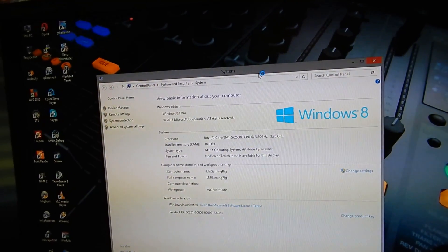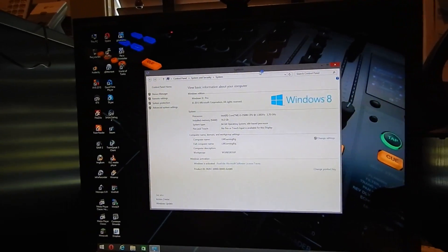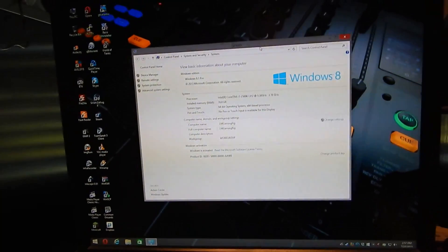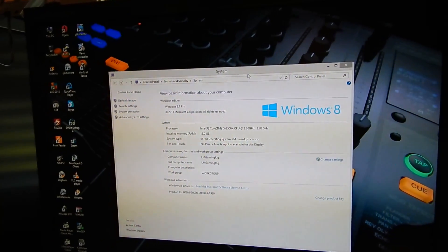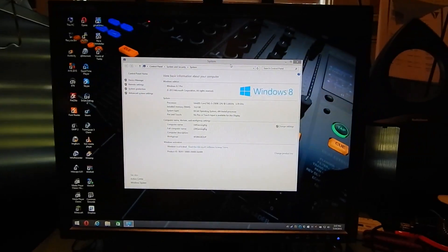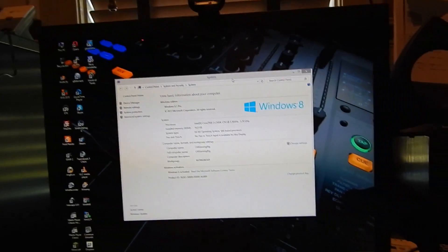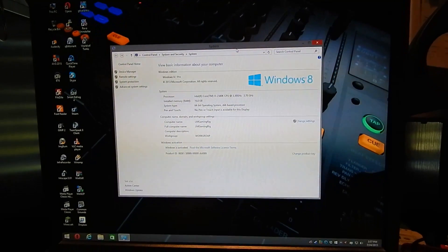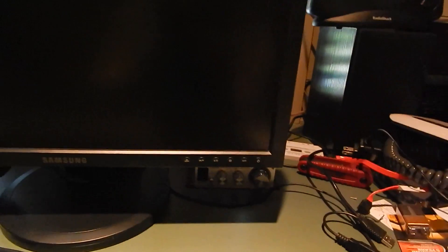That Radeon R7 370 is a really good card actually — I've been using it to play a few games here and there and haven't had one issue while gaming. I have had one issue with the AMD drivers though — typical AMD/ATI driver problems that have been a thing for a long time. When the display is set to sleep in the power management settings, sometimes the display will turn off and won't turn back on again. It's called display loss. This is Catalyst 15.7, which had a lot of major feature upgrades, so I'm assuming there are some bugs they haven't worked out yet. What I've done in the meantime is just turned off all the power management, and if I don't want the monitor on I'll just shut it off manually.